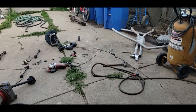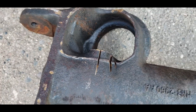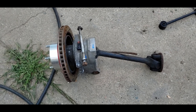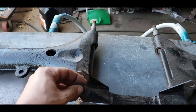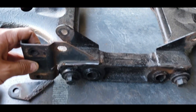You can keep your stock batwing assembly if you want, but mine got chowdered up pretty good because my bushings were locked into my struts, so I had to hack them off. Luckily, the new one came with it. Now you can see my wheel lines — these are some other things I'll have to transfer. They come apart really nice, maybe five minutes of work and they're off. Because of the lack of sway bar on the 95 to 97 unit, it just had these wings on here, which I've cut off. I also cut off my brackets that were welded onto the assembly, and now I'm going to mock these up and weld them on.